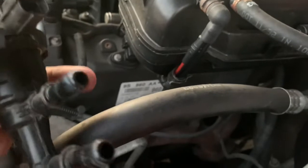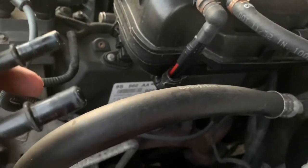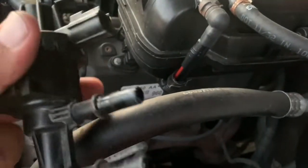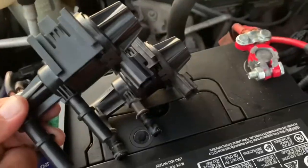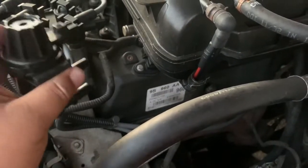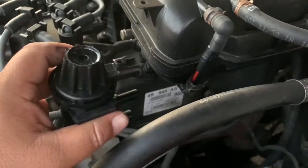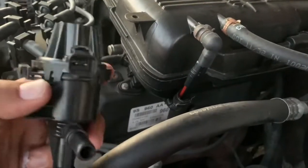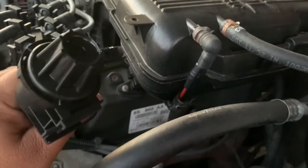Ready — with that they come out. Now they are color-coded: the top one is white and the bottom one is blue, and they are also different diameters. We are going to put the new one back, which is the same. This is how you change the purge valve of the evaporation system. The causes of this — normally when you start the car it starts a little hard and sometimes there is a smell of fuel.